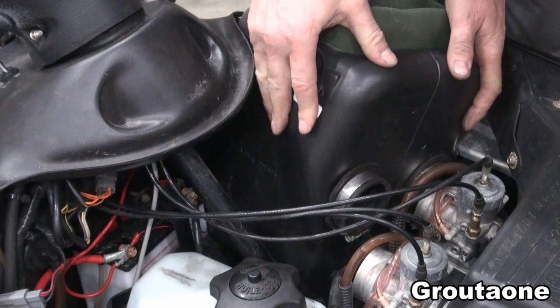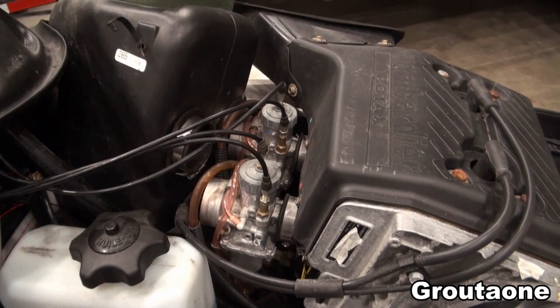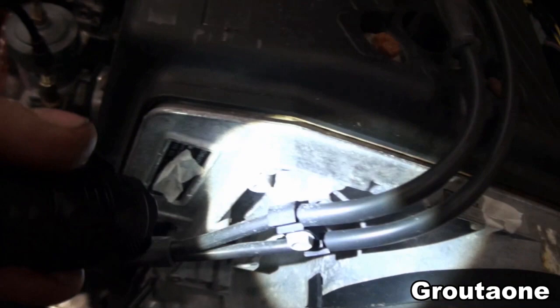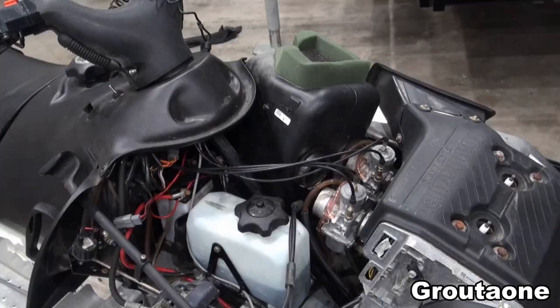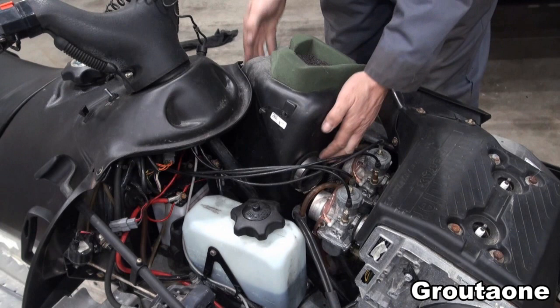Oh, it looks like there is something attached. So the ignition coil is bolted to the airbox. See? Spark plug wires. Follow the wires right to there. This has a coil there. So I'll remove that coil, then I should be able to get that airbox out. So change of plans. I thought I would leave the coil on the box and just remove it out as one assembly.